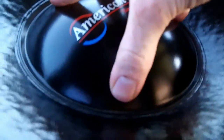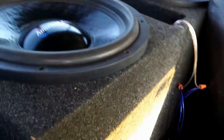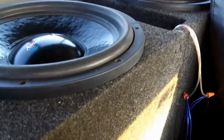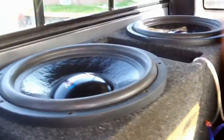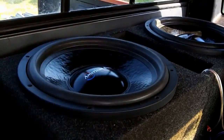As of right now things are stiff as a bitch. I'll be making like a six and a half cubic foot box, ported and tuned to like 30 or 31 Hz — should get a lot louder. The gain on the amp is only set at like a third for now and they only move like maybe that much at the most.